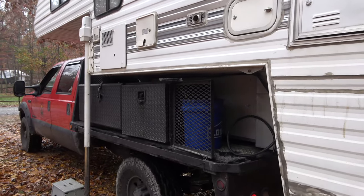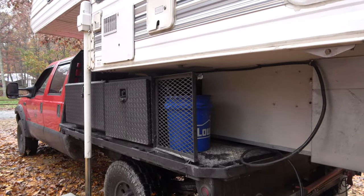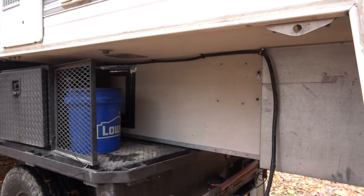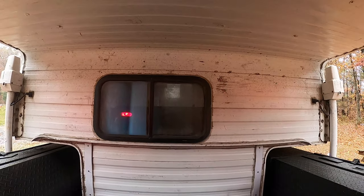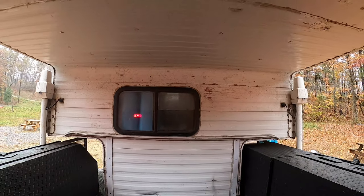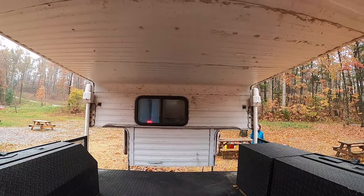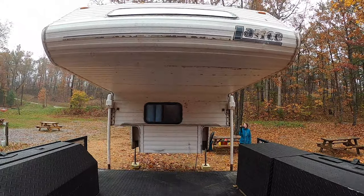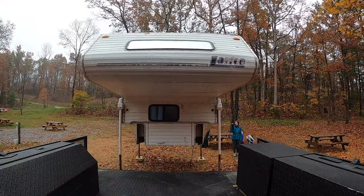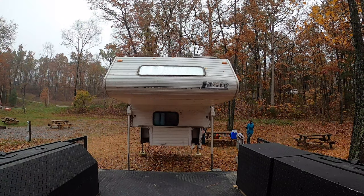Now that the camper is lifted up off the truck bed, you're going to want to start your truck and move slowly forward. Be sure to check the side mirrors constantly to ensure that the truck is not hitting anything or hitting the jacks at any point. Note that with a standard truck bed, you'll have far more room than we have with our flatbed setup. Now that the truck is pulled away from the camper, the camper is suspended in the air on top of the jacks. You're going to want to lower the camper back down toward the ground — we like to have only 6 to 8 inches of the camper off the ground suspended on the jacks.